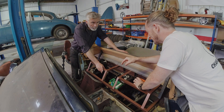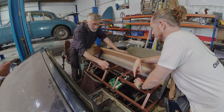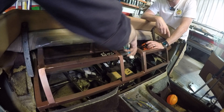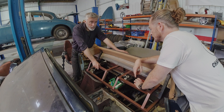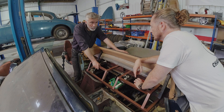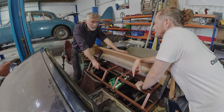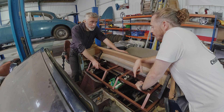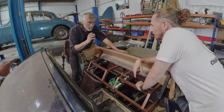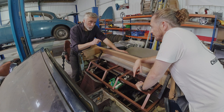You need the trickle of battery power to the inverter before you put the full charge in. So this pack will have the pre-charge and the pre-charge resistor — a big resistor. Both packs will have fuses, and both packs will have a positive and a negative contactor. There's a really important reason for using two contactors. I have seen some conversions where they don't put a contactor on the negative, and that's extremely dangerous. The failure mode for contactors is they weld on. If you've only got one contactor and it fails on, your battery is live when you turn the ignition off. So if the vehicle is involved in an accident and emergency services come to rescue you, there could still be 400 volts around the vehicle.